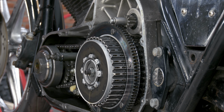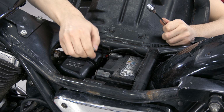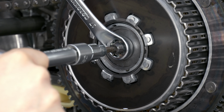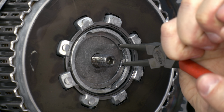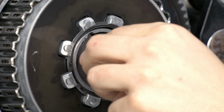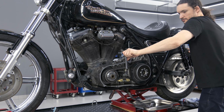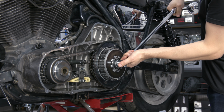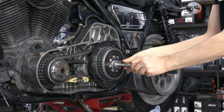It's recommended to unplug the minus battery wire to avoid accidental spark and starter launch. To remove the clutch, first loosen the nut, remove the snap ring and release plate. Next, block the rear wheel with the highest gear and foot brake. The nut has a left-hand thread and is fixed with a thread lock, but can be unscrewed easily with no problem.